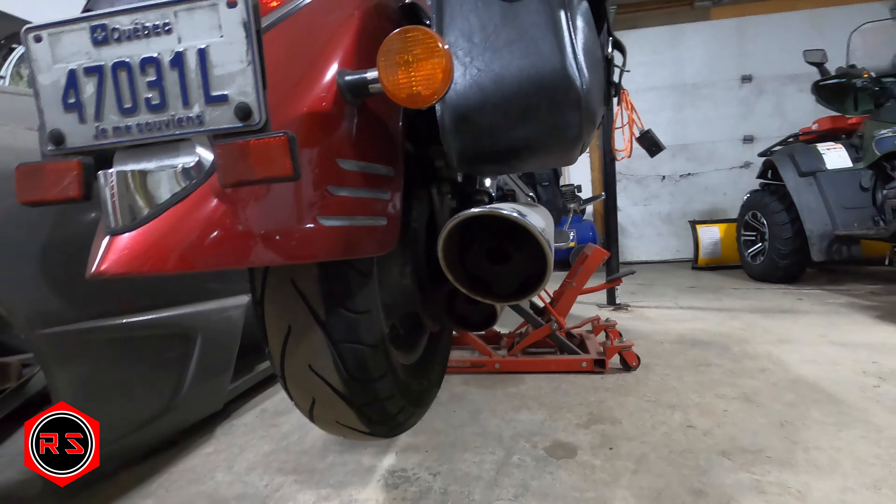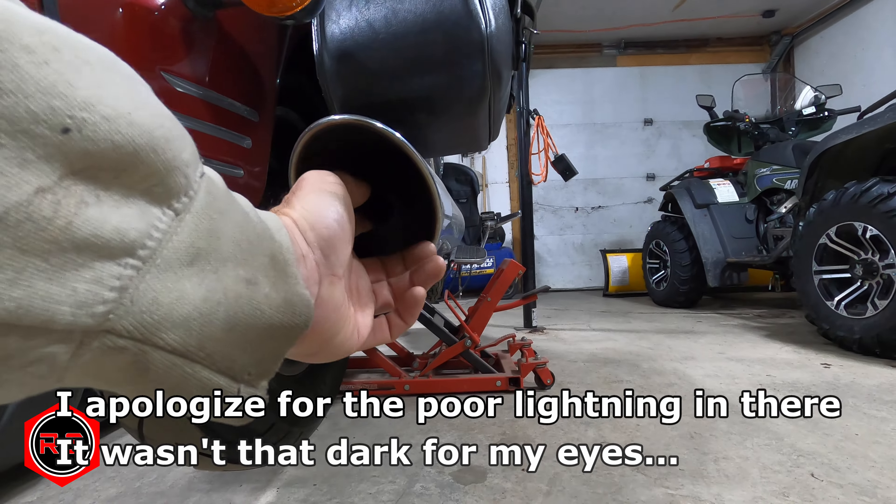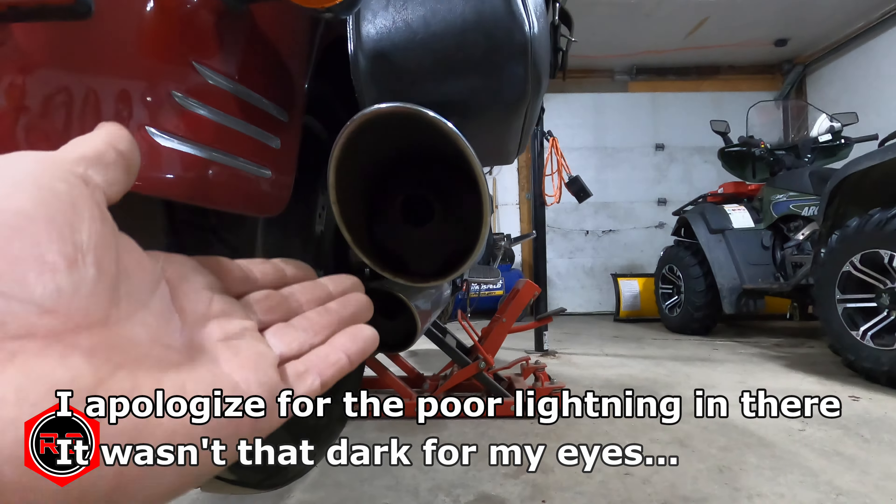The tip of a VTX 1300 has kind of like three inches of pipe at the end of the baffle that tilts down a bit. I will start with maybe eight holes total, one on each position in a cross pattern. After that I will do one every other hole on both mufflers and see how it sounds. I may start with four, fire it up, and see how it sounds — if I'm satisfied with only four I'll stop there, if not I'll add more.